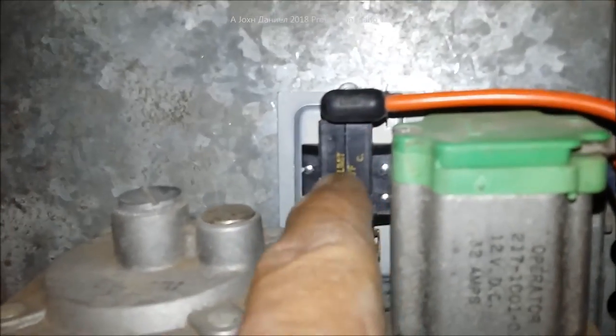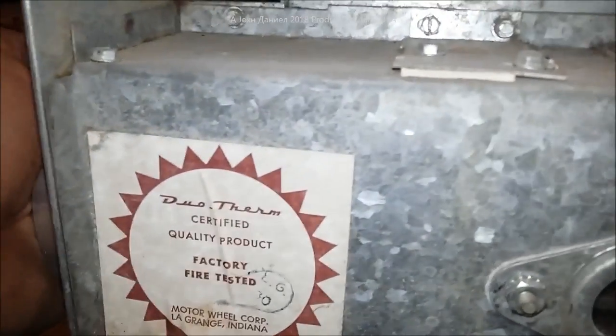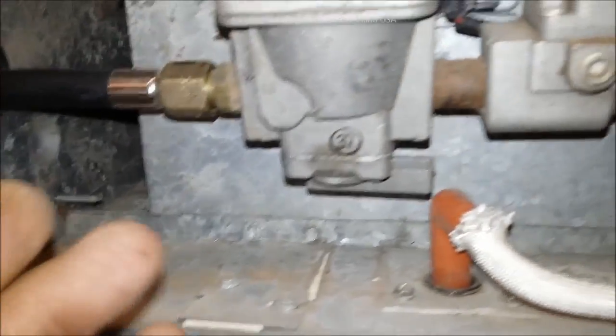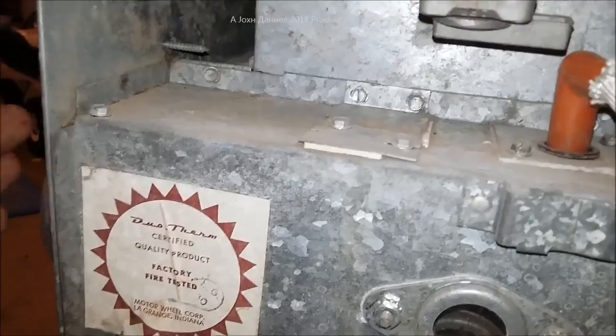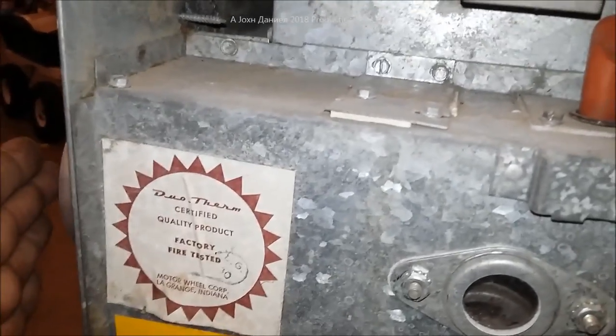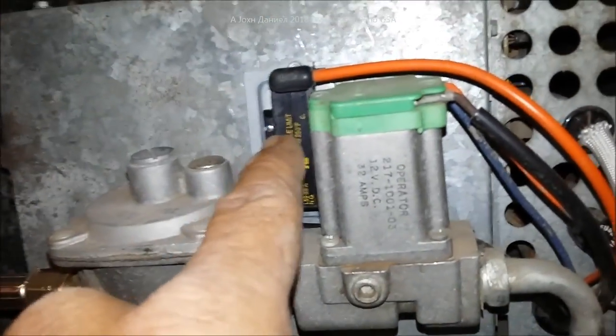I mess with this up here — nothing. One of the real benefits of having one of these is that RVs are mice-attracting machines. If a mouse builds a nest in here and starts blocking the heat off, and the heat cannot escape while the gas is running, the results would be that this thing would overheat and you'd have a fire. If you smell mouse urine or waste in your heating system, it's time to pull your ductwork apart and look in there. Also dirt daubers can build up and prevent the heater from exhausting — it could overheat. This shuts off the gas; it's the best thing in the world to have on one.